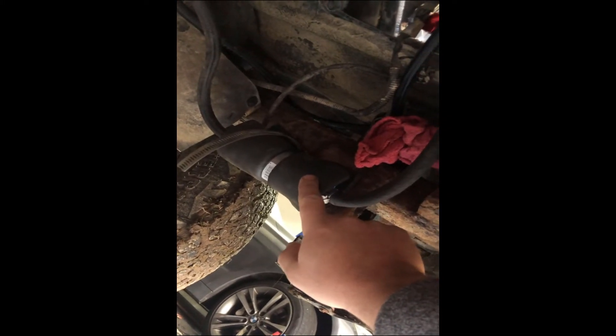Underneath, he's got his fuel pump mounting. This is just a $300 beater, so he didn't use the bracket I gave him — just a quick install. He used a hose clamp to mount the fuel pump. This is off an '87 E30. This will work on just about any application. They move a lot of fuel — high fuel pressure and gallons per hour — and they're inline.